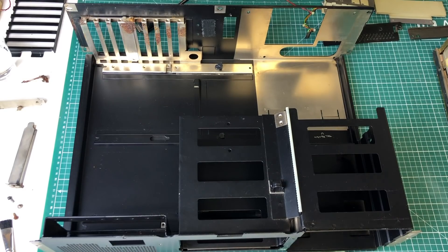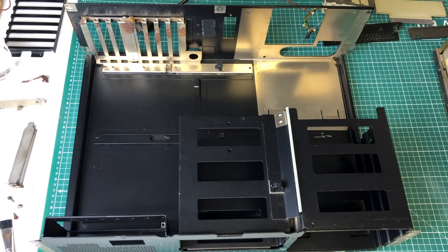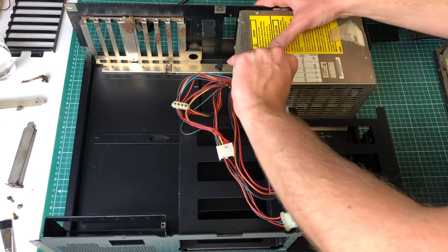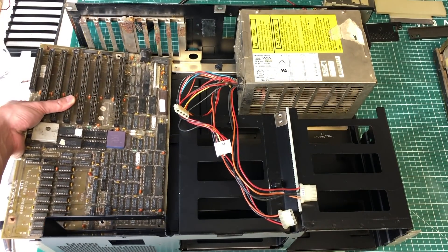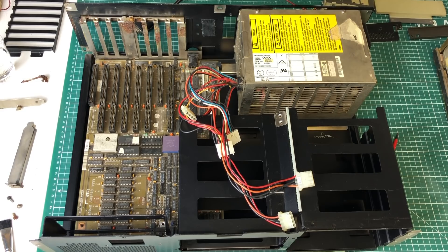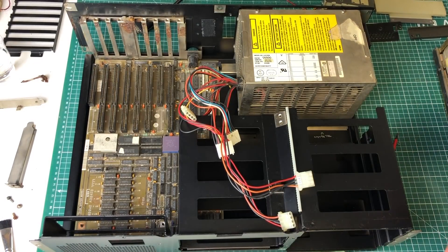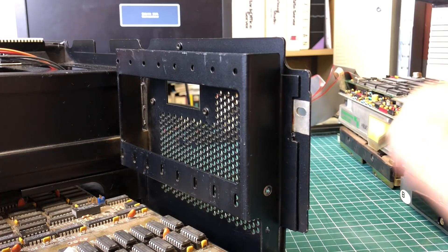The case cleaned up very well, except for the back side which still has a lot of corrosion that we'll tackle later. Unfortunately I didn't have enough time or sunlight to clean and dry the power supply, so I'm just going to hook it up as is. The same goes for the main board — I will be cleaning it properly but that will be for a next video. I've decided to use a VGA card for this build, as it's just a lot more convenient to hook up a VGA monitor, and despite it coming with an MDA card, a lot of these 286 systems came with VGA.